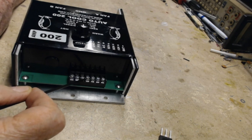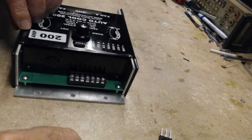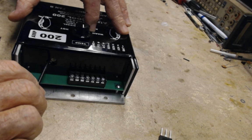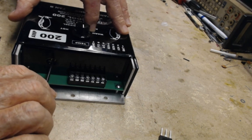This is the AC pin — you can tie this to 12 volts through your ignition through your AC system. It turns the fans on to a speed selected by this little potentiometer back here under this hole, adjusted with a little flat blade screwdriver.